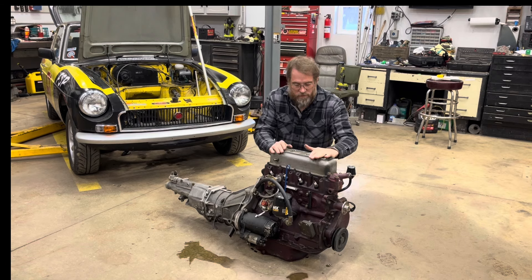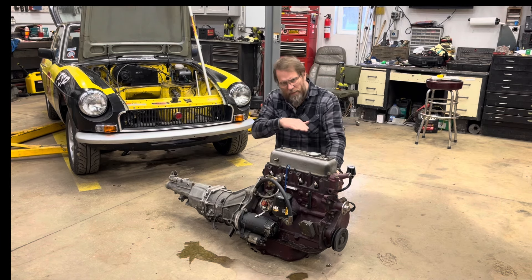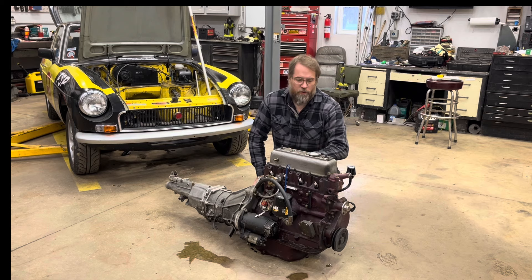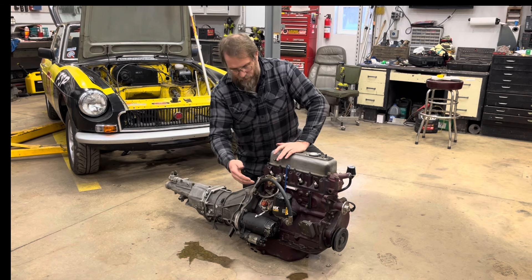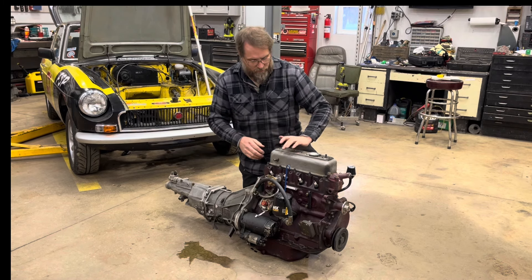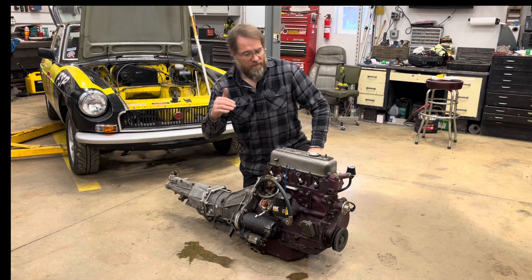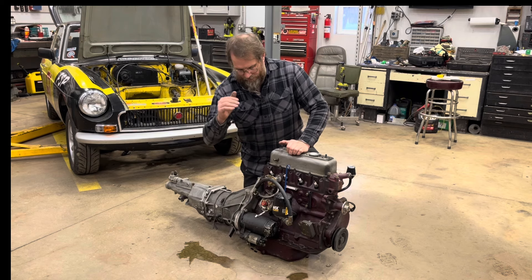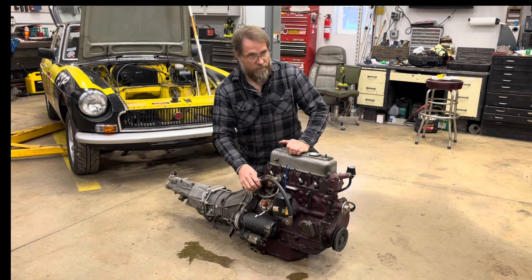Now that the long block's done, I need the cylinder head, so we're going to pop it off. It's going to have to go to the machine shop for at least a minimum of a skim, but we'll do a cleanup on it, check it over - I might CC the chambers, might do some touch-up work. This distributor has already been rebuilt and curved to go with a 60-over, nine and three-quarter to one compression motor, but it was curved factoring in the APT VP11 cam, not the VP12 that I have now. We'll go ahead and throw it in and see.